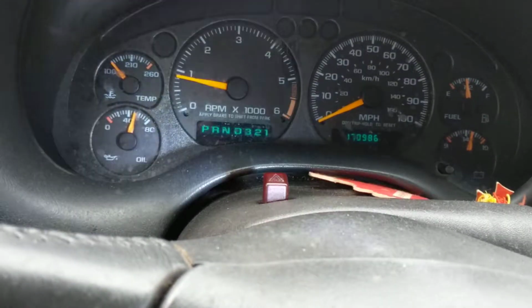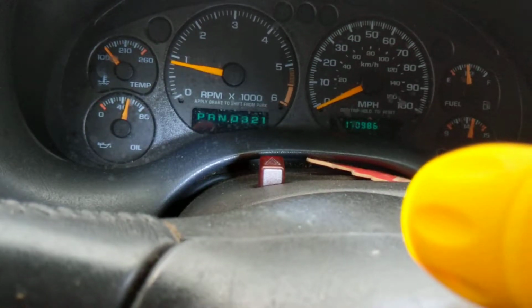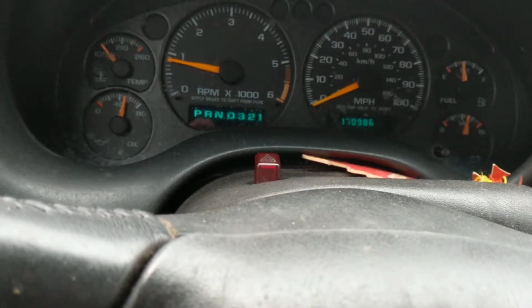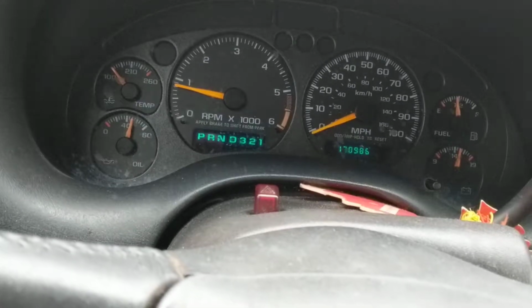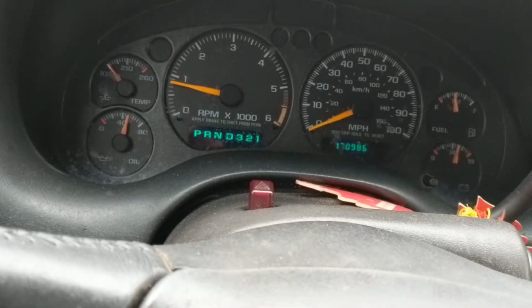The oil pressure, like I said, will go down. Right now it's over 50, 60, about 55 psi, close to 60, because we just turned it on. Remember, the oil will thin out, and then the pressure will go down to about 20 psi.